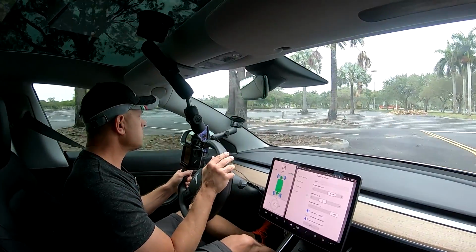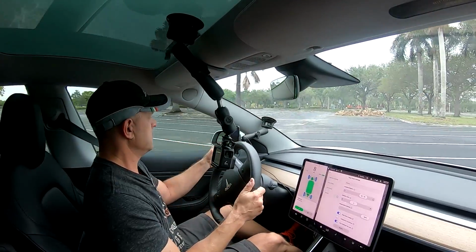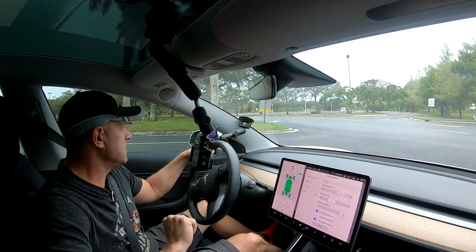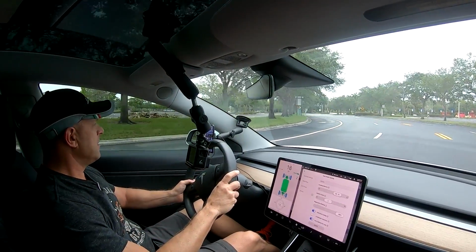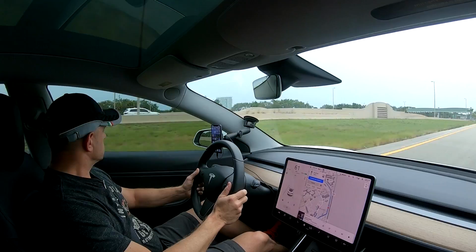We got differences, you know, the suspension's dropped a little bit. We got the thicker sway bars, not even on the most aggressive setting either, now that I think about it. So really, really impressed with the handling pickups that we got with the lighter wheels, dropping the car, and the sway bars.